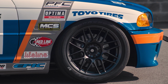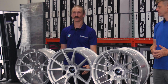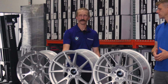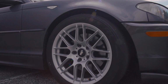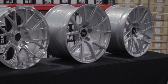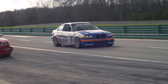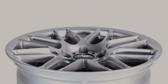Like a lot of things in this industry, parts that people oftentimes think are not consumable actually are consumable. And wheels certainly are one of those. And you know, there's obviously the lifetime of a wheel, you know, part of what you're buying with a forged wheel is extra life in it, right? Flowform still has plenty of life, quality wheel. But the failure we typically see, and when I say failure, again, I'm talking about a nicely designed wheel where, unless it's a major impact, ideally it doesn't even lose air in the tire and keeps you racing or gets you home if you hit that brutal bridge seam. But the point that's going to be damaged is often that barrel. And so adding the extra strength is really a major focus for us.